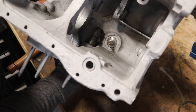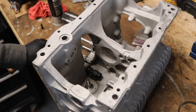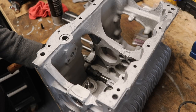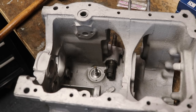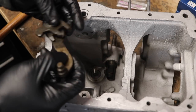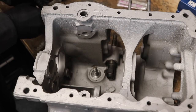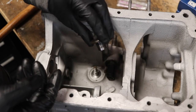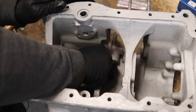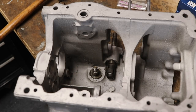With that in place, we need to make sure our gear selector shaft isn't too far forward or too far back — it needs to be perfectly in the middle position. Now we're going to install our shift linkages, or shifting forks. You start off with the actual pivot bushing, which slides down on there and should move freely. If it's binding, you have a problem.